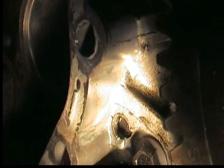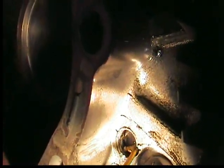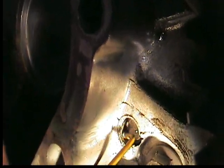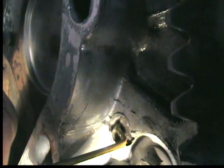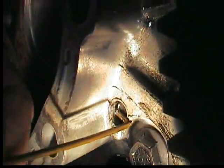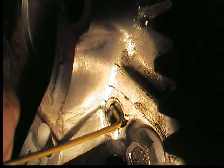Here, as you will see, I'll demonstrate. With this, there is a little notch in here — there is a lip that they put in here that prevents the dowel pin from coming out. There is no way for that pin to come sliding out like they used to, because that lip was not there on the prior cases. It is kind of tapered inward towards the end, which prevents the pin from coming out. So there is a lip in there that they corrected that issue with.